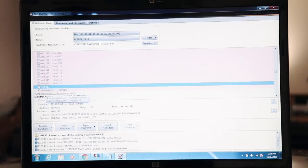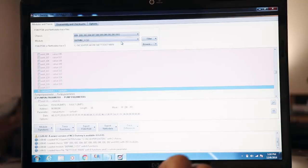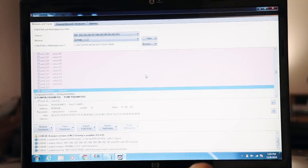A032FF2D. So now we're running custom data. That's it. We've essentially hacked the ECU, took hints off of the model that runs ethanol from the factory. It's compatible. Now we can push this back into the ECU.